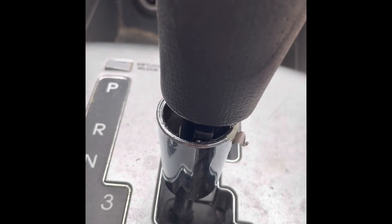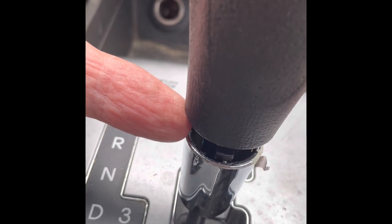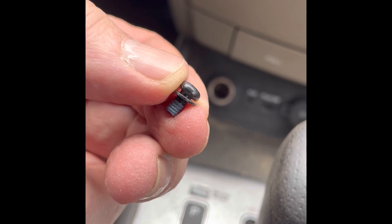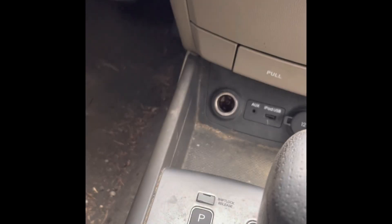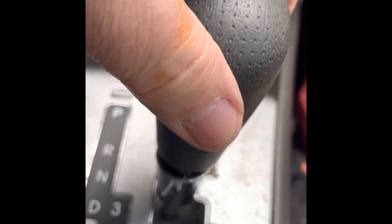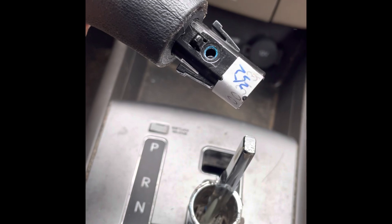Now, that's only part of it. On the side, right here, there's a Phillips screw. The Phillips screw we took out is a tiny little screw, and here it is right here. That's the screw that comes out. So I'm going to take the handle off and just pull straight up — no effort. Comes right off and you can see the hole there where it goes in.